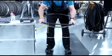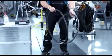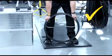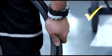Starting at the valve, pull the tire uniformly into the tire bed on both sides. If the tubular tire cannot be pulled onto the rim or it requires a great deal of force, it absolutely may not be stretched. The tire could be damaged and it would no longer be guaranteed that it sits reliably on the rim. Instead, modify your technique.